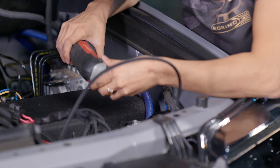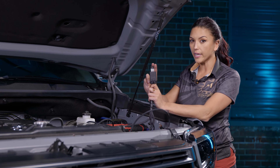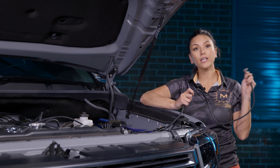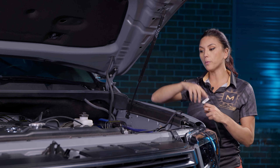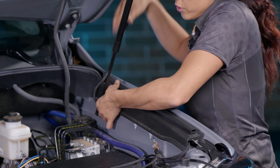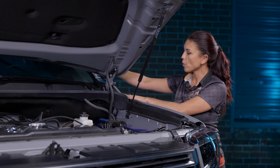Take a small drill bit and drill that hole out. With the relay, very importantly, make sure it is installed vertically and not horizontally. Place it down in the hole. Now that the relay harness is mounted properly, run the light 2 harness — for the driver's side light — up underneath the plastic trim piece on the side fender of the truck. It fits nicely; tuck it up underneath there with some excess, then pull it fully through and pull some excess back into the engine bay.